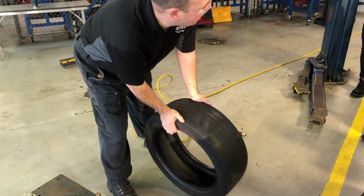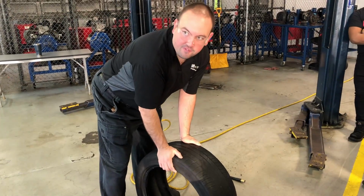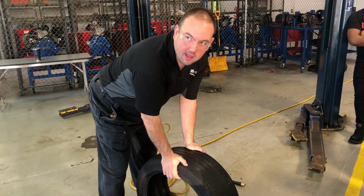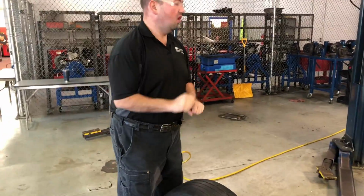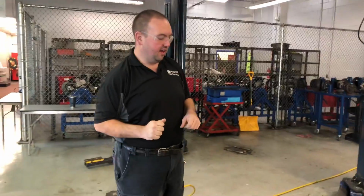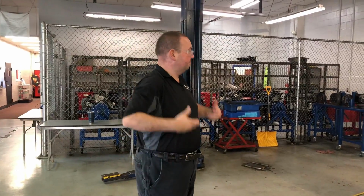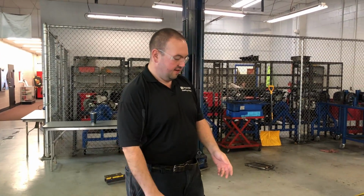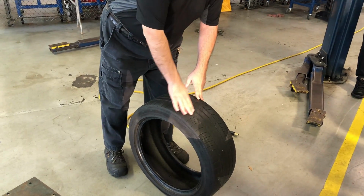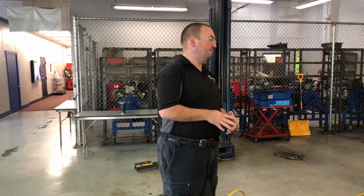This whole spot, every time you turn, every time the car corners, that shoulder is flexing all the time. So any repair we do there is getting worked all the time. Okay? So, sidewall, same problem. So I can't repair the sidewall, I can't repair the shoulder. But if the customer comes in and they have some type of puncture in the tread, I can repair that.